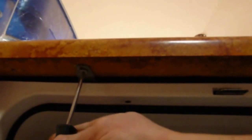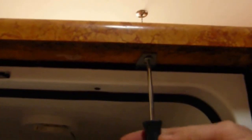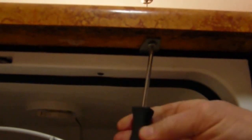To investigate further, we have to unplug the dishwasher from the power supply and shut off the water. In order to physically get to the heating element, we're going to have to pull the dishwasher out from under the counter. Before we start moving things around, let's put a soft mat in front of the dishwasher to protect it and the floor from damage. Dishwashers are commonly secured to the counter using two screws, and we need to remove them and the kick plate on the bottom before we'll be able to move it.